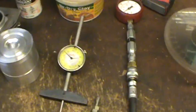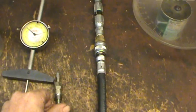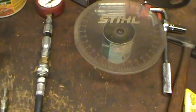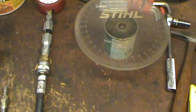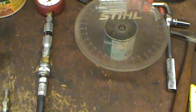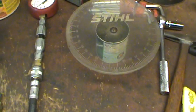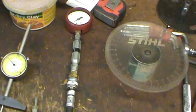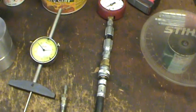I need to know the degrees and top dead center. I put my piston stop in and determine top dead center, put my degree wheel on, set my pointer to zero, and measure my exhaust duration — or measure from top dead center to where the exhaust port just starts to open. So let's say we've got an exhaust duration of 160 degrees. We subtract 160 from 360 degrees and end up with 200.